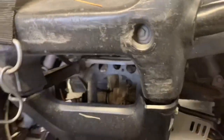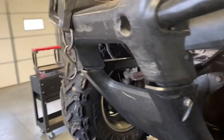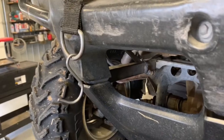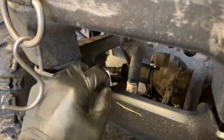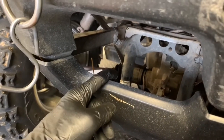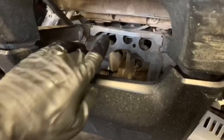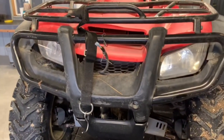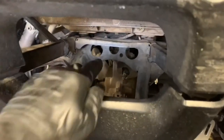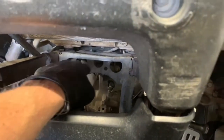Right here is your front bumper on these machines, and they put the VIN number in a really difficult place to see. A lot of times I'll have to use a mirror to see them. There is your model number there — this is a TRX500FPAC. You also have a color code there, so that'll give you an idea of what model your four-wheeler is. Your VIN number is right here — there's no good place to see it, so I grab a mirror and angle that down there. You can read the VIN number stamped right across this rail in that frame piece there.